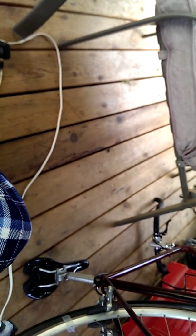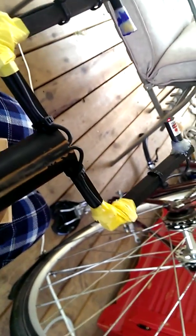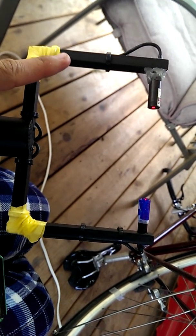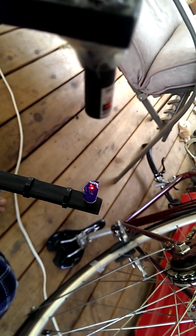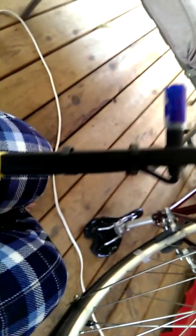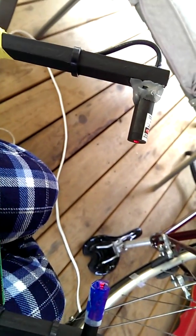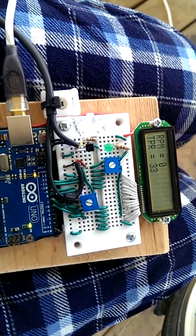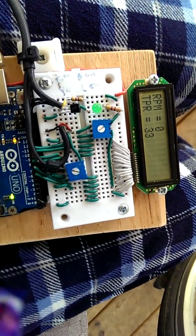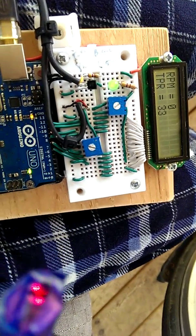Here is the beam here. It needs a little bit of work, but it's just a mock-up for now. So I have two wires — one of them comes up here to a laser pointer and it shines over at a receiver. It's a photodiode set up in a circuit on the board here as a phototransistor, and it basically toggles every single time you break the beam. It sets off that indicator light, but it also has a voltage change that triggers the Arduino interrupt to let it know that there was a trigger.